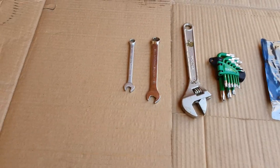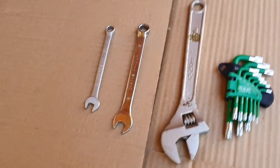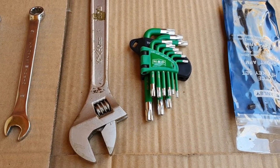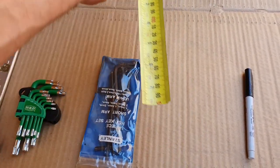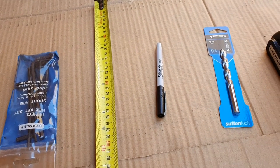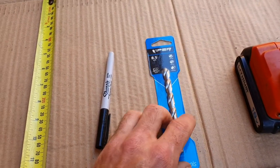Let's take this outside and I'll show you what tools you need. Number one is a 10mm spanner. Next you'll need a 13mm spanner, a shifter of some description — or a 22mm wrench or spanner. For a Ford Ranger you will need a T30 Torx bit, that will undo the bolts at the back of the ute tub. You'll need a 5mm allen key, some sort of measuring device. The instructions call for an 8.5mm drill bit, which was difficult to find.